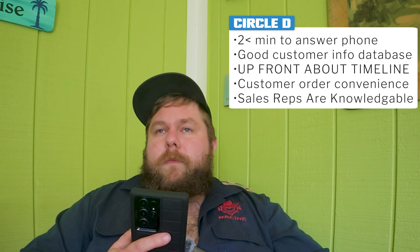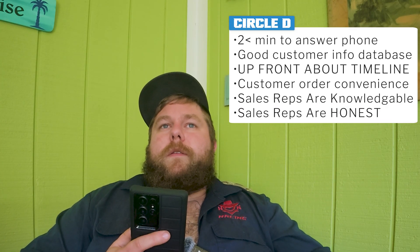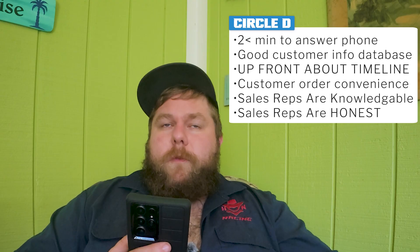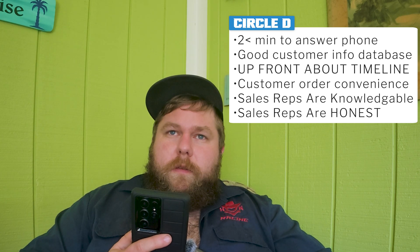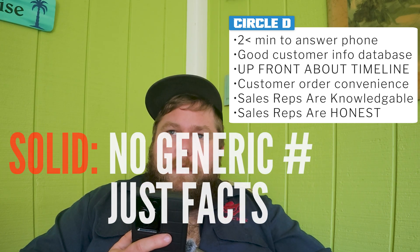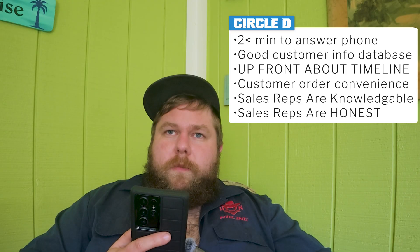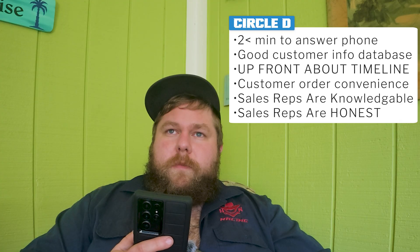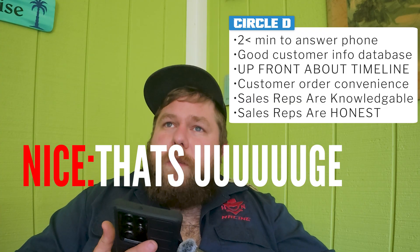It's pretty much intended for track-only use or very limited street, being that it's non-lockup and spragless. From a temperature standpoint it will generate more heat than a more standard configuration. The stall target would be mid to high four thousands on the trans brake leave RPM, and that same converter should flash past maybe 5,500 to 5,800 RPM — loose down low for quick spool on a big single, and it won't couple aggressively, keeping stress off the rods.